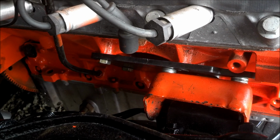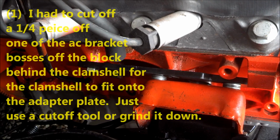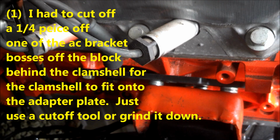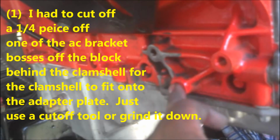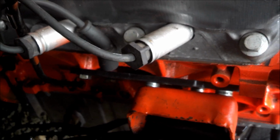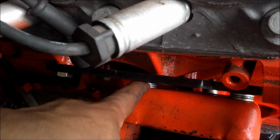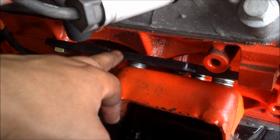All right, here's what we got. We have Car Shop Inc. 1-inch setback adapter plates, for LS engines into an early model small block Chevy chassis. About 60 some bucks. They're great. I love them. They're awesome. Only problem is they don't come with the bolts for these. That's the only issue. I used the ones out of the Transdapt kit that I had.